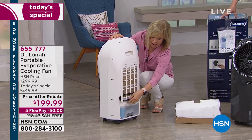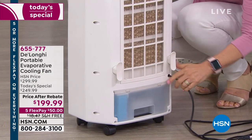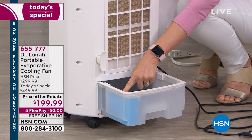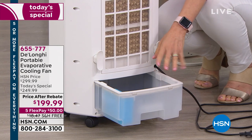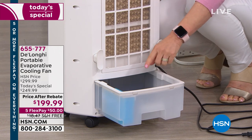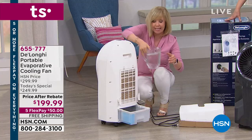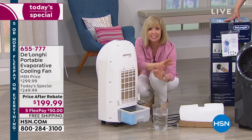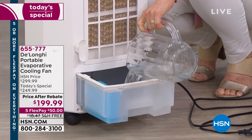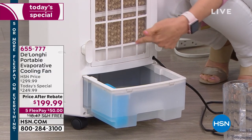Here's how it works. It's got a six-foot power cord in the back. It has a bucket in the back — you can pull your bucket out, and it comes with an ice pack. The key with evaporative coolers is the colder the water, the better. You can have your ice pack right in there. If you want your water colder, add a few ice cubes. It holds a gallon of regular tap water and runs for up to six hours. After the six hours, you can just refill it, and if it runs out of water while you're away, it just kicks into fan mode.